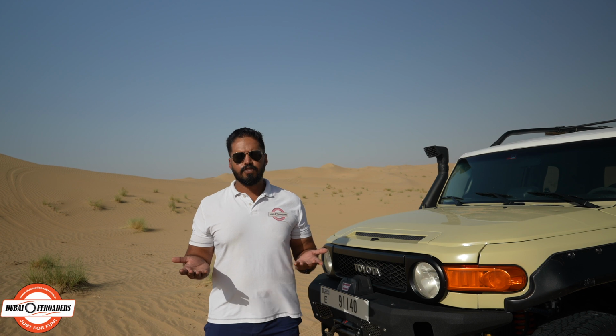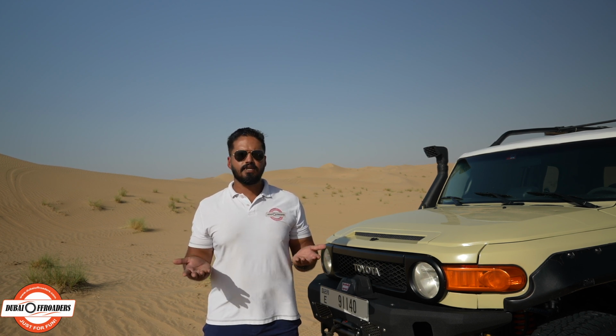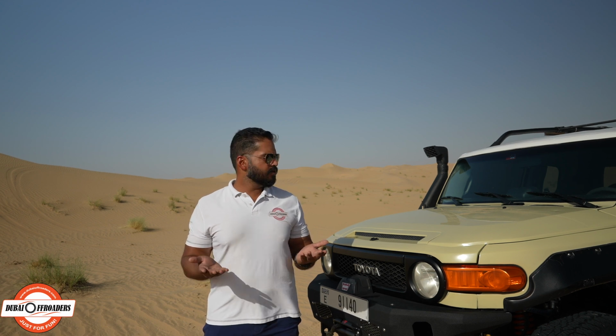When you're driving on the sand, you're constantly balancing traction and power. If you have too much traction, not enough power, your car's not going to move. If you have too much power, not enough traction, you're going to spin your tires and actually dig in instead of moving forward. So for us to be successfully able to balance these two, we let some air out